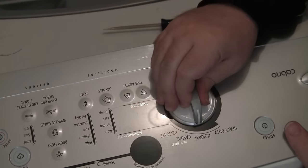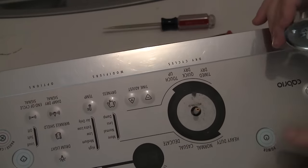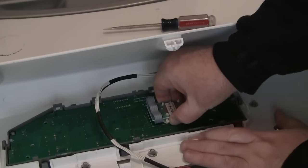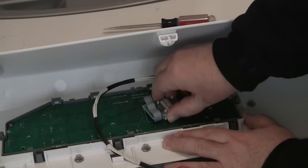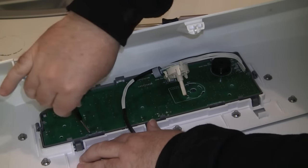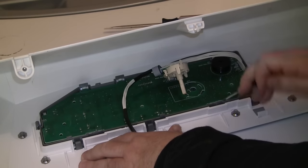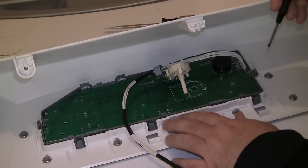Now you can see the user control board, but before you can remove that you'll need to remove the dryer knob. First simply pull the knob off from the front of the dryer console. Then on the control board, pinch in the small tab that's on the knob connector and rotate the entire connector a quarter turn counter-clockwise. Using a flat screwdriver, pop the circuit board out. There are three main tabs across the bottom of the board — just work the screwdriver into those openings and carefully pop it out.